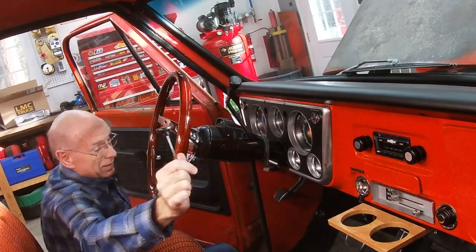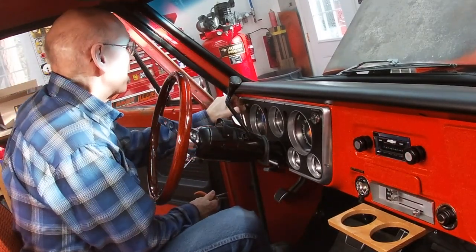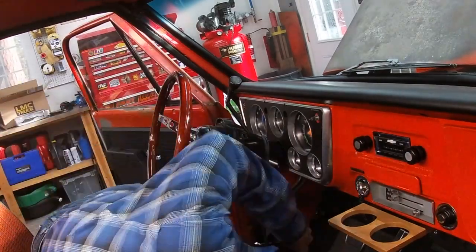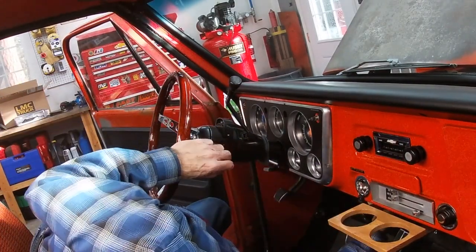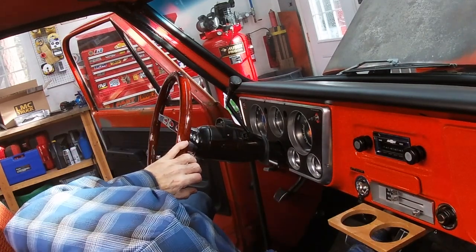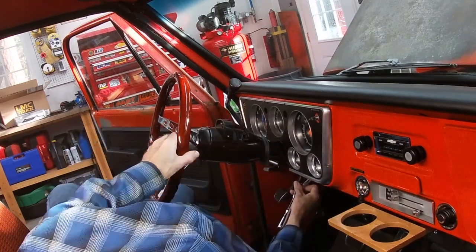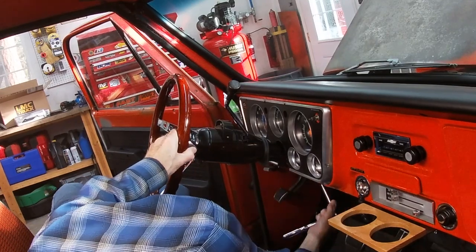And the headlight switch, you have to reach up under there and push a pin in so you can take out the stem. And so then I'll take the bezels off on the front of that. The next step here is, underneath there with a 5/16 wrench, taking off the oil pressure sending unit, or the oil pressure gauge hard line. And then after that, I'm loosening up the two bolts that hold the steering column to drop it down just a little bit to make it easier to get the dash panel out of there.